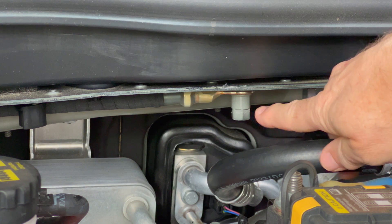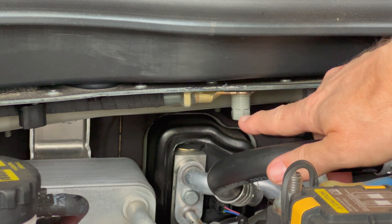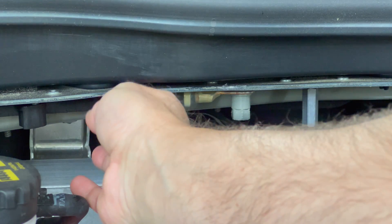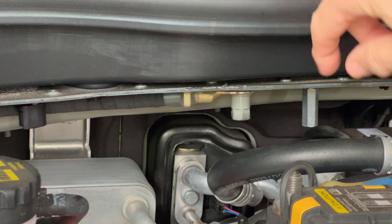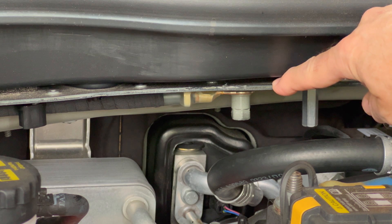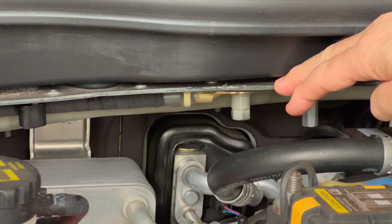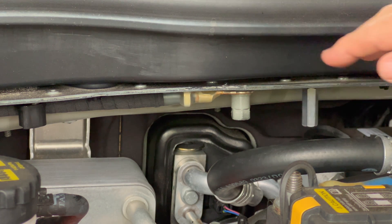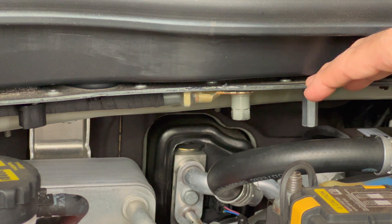You can see the connection. On some vehicles this bolt may be loose, and you could move the cable. Fortunately mine is on tight and my cable is not moving. If the cable is loose, you may get sporadic problems with the 12 volt battery. It may cause problems with subsystems — you may get locked out of your vehicle or have an issue where the car shifts into park.